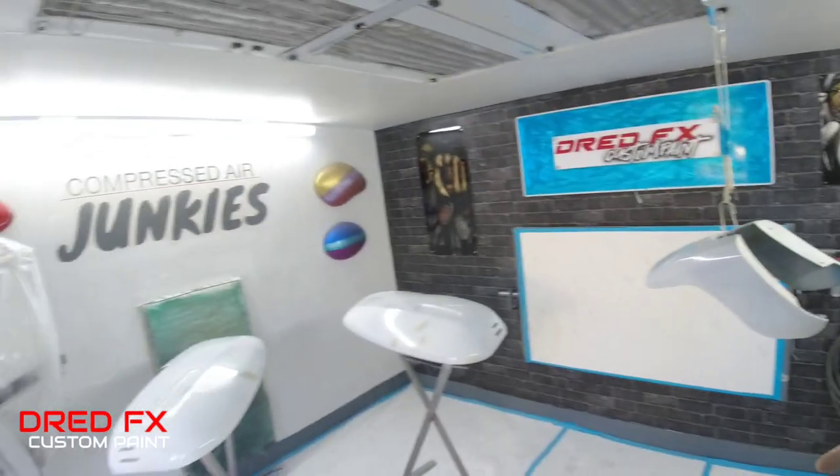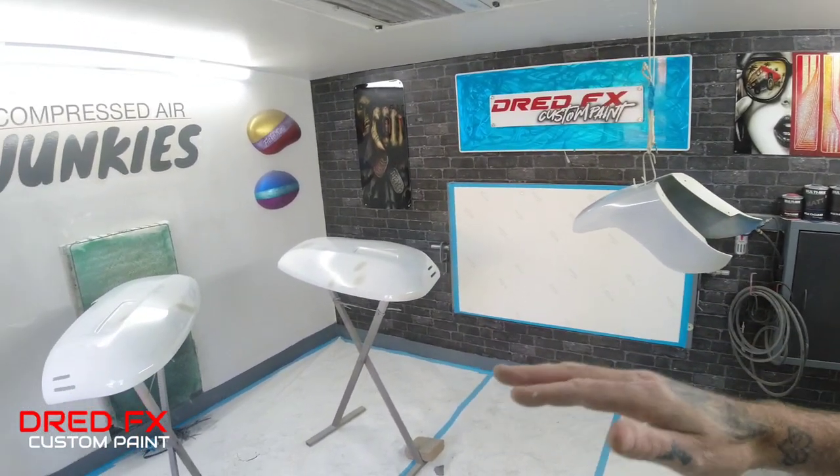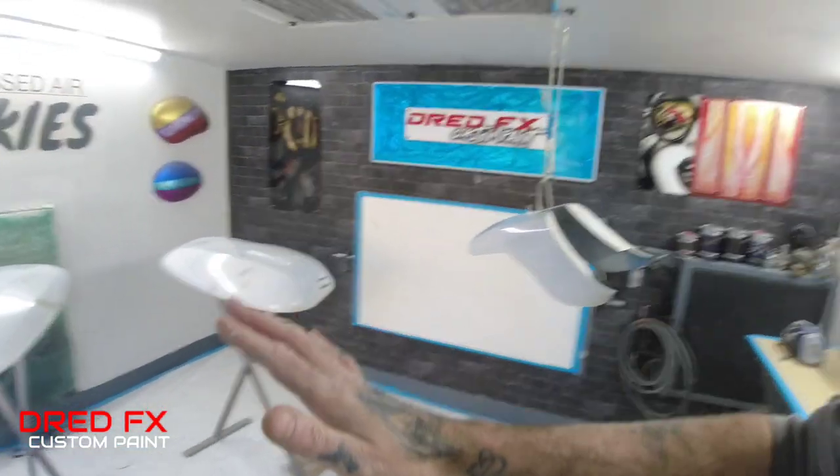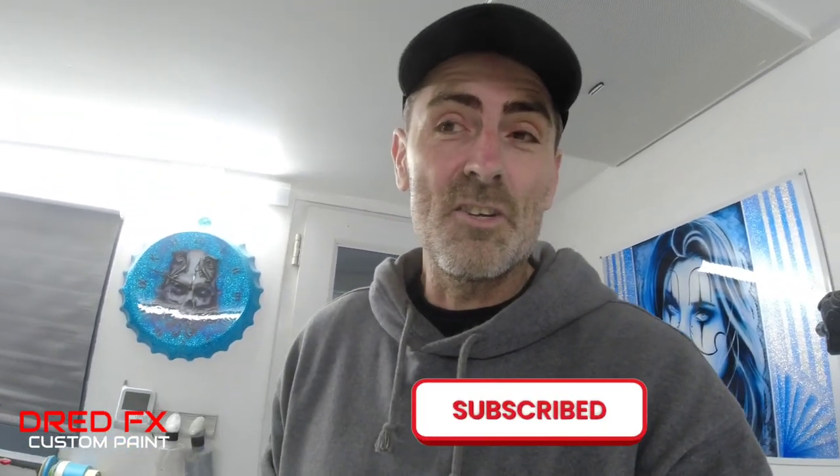In those time lapses we've prepped the panels up, given them a good clean down, blew them off and dropped some primer down on these just to seal them off — just one coat of primer over the top. We've got the case in there — that's in primer. We're going to leave these to dry overnight, keep the heat on and let them dry right down. Then we can come in tomorrow, guide coat all this up, prep it all up and get some base coat down. I know it's not a great video — there's a bit of prepping involved — but these things you have to get done before you can start putting the fancy paints down and getting them ready for artwork. I'll see you in part two — we'll get these prepped up, get some base coat down, start the artwork and get them up into clear. Thanks for watching, don't forget to subscribe, hit notifications, drop your comments and I'll see you in the next one. Cheers.